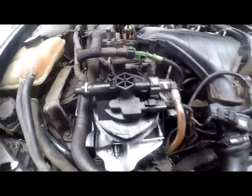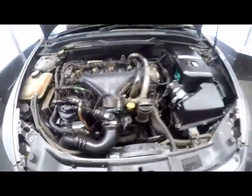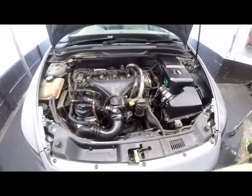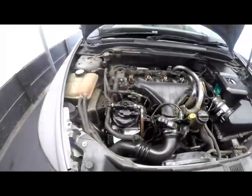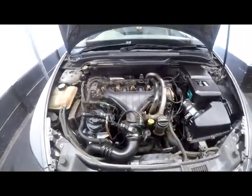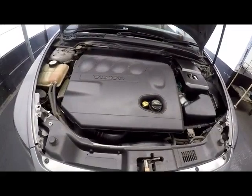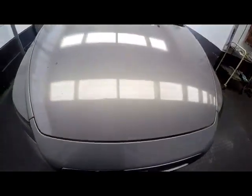We've gone through the bleed system — there was quite a bit of mess but you can clean up nicely. Now we're basically ready to start. You can still see some air coming out through the cracks but it will take a while to bleed out. As long as the car starts, you have pressure on the pump side pulling the fuel through the filter, and it will automatically expunge any extra air. That's basically how you replace a diesel filter. Don't forget to put your brackets and the engine cover back on, then the job is done. Alright, all the covers are back on — close the bonnet.